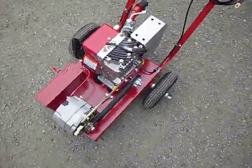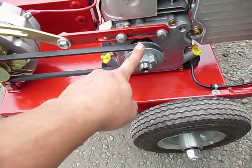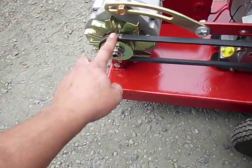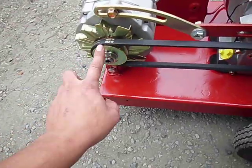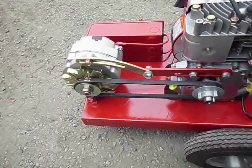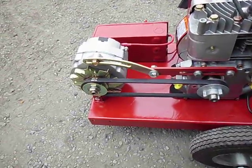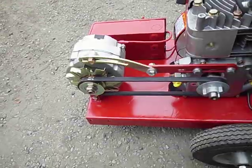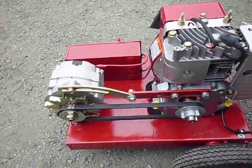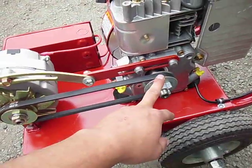Over on this side, it's a three-quarter-inch bore, two-and-a-half-inch pulley with a half-inch wide belt. This is about a two-and-a-half-inch pulley, and the alternator was designed for a three-eighths belt — you can see it's slightly riding up on the edge. That's actually a nice thing because it slightly under-drives the alternator. Since I had this custom built to reach full amperage at low RPM, running at about 1,100 RPM gives me full voltage and full amperage with no need for a larger pulley.